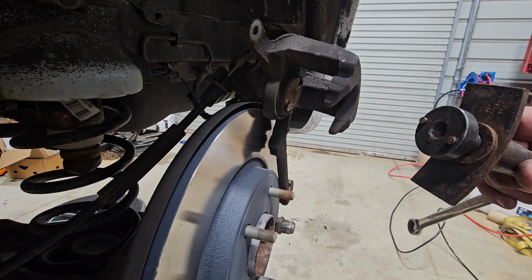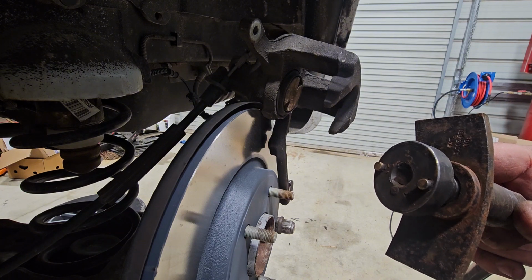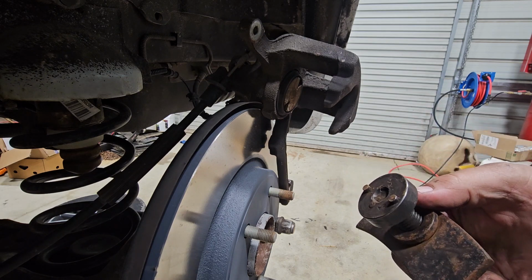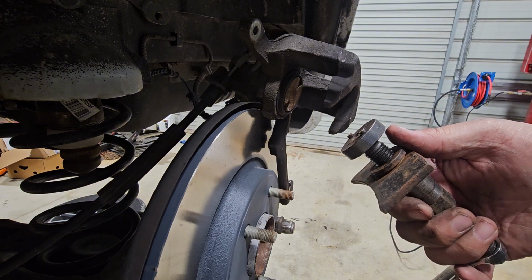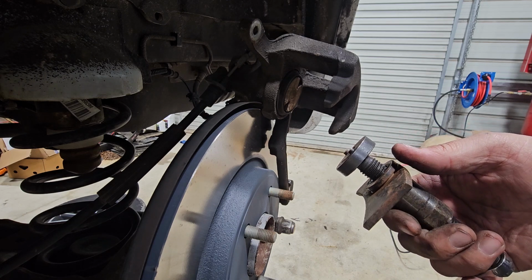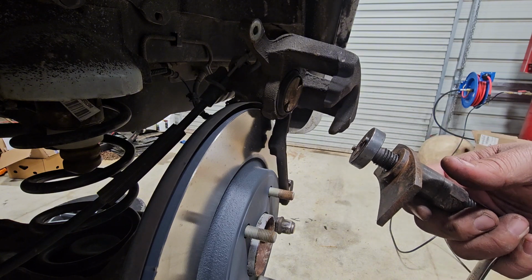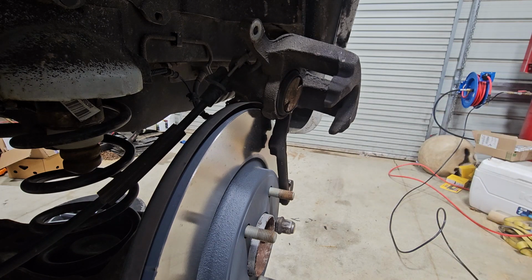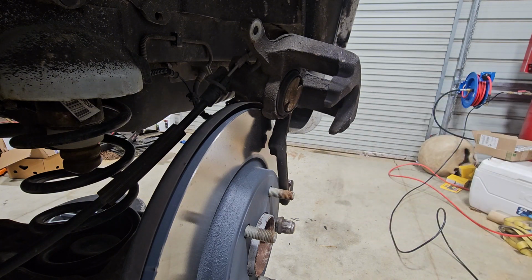I've seen guys use channel locks and do it and push it with a pair of vice grips. I don't recommend that. You can tear them up. Or you can get just this and put it on a 3/8 extension, turn it and push at the same time with a C-clamp or something like that. That's a little bit better than the other way. Or you can turn it and push into it, and it'll go in, but it's a lot harder to do. It's much easier just having this tool. Makes it a lot faster, simpler, and as you can tell, it didn't take any time at all, because that was in real time right there.